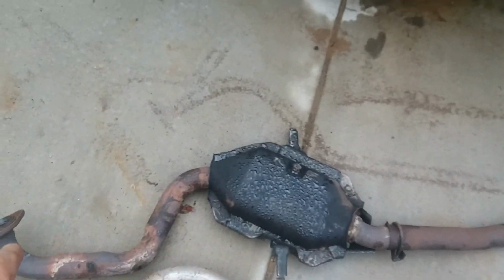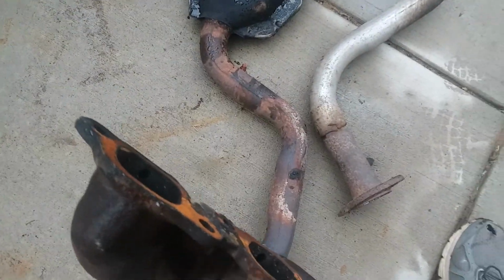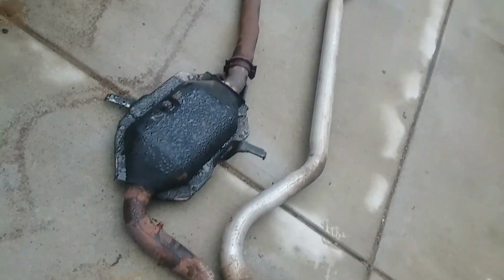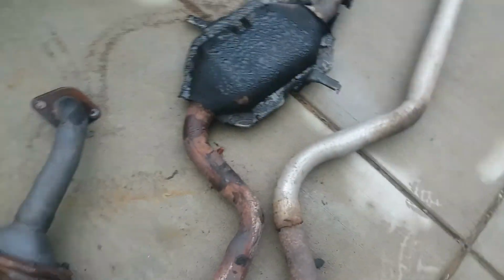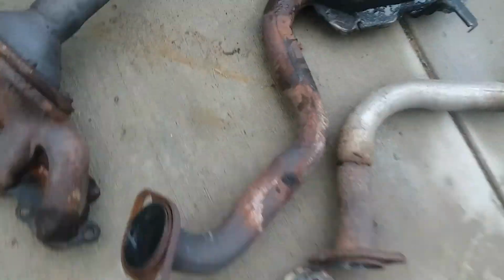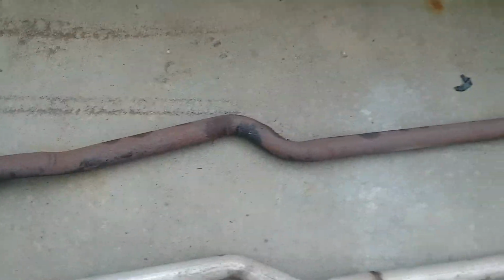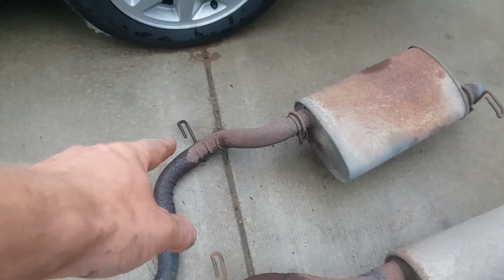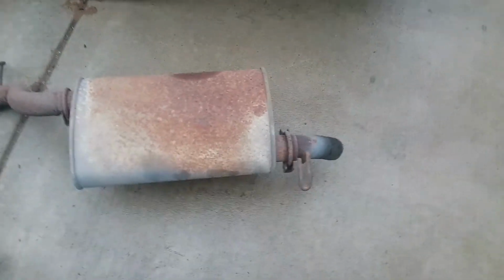They all take a different exhaust system behind it. So this one here that I have that has the dark catalytic converter, this is for the base exhaust manifold. We'll stick it in there just like that. This connector goes right underneath the oil pan, and then it makes a couple chicanes, and right where the firewall starts are these hangers. These hangers are perfectly in line with the firewall, and then you go straight for a while, make some dips and dives, and then your last hanger before the muffler is right there, and your absolute last hanger is on the tailpipe.